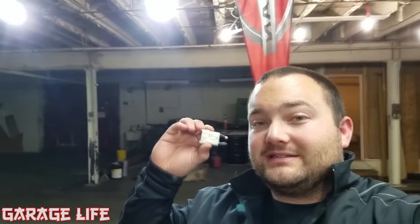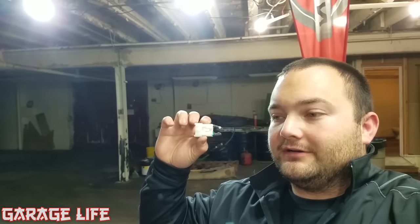Ron makes this — it's a lamp failure module connector bypass. What's actually going on with the Supra is the brake lights don't work. Ironically, what's making the brake lights not work is a lamp failure module in the back of the car, which I'll show you. Tony said the other day, 'You just need to rewire your car, it's your fault the brake lights aren't working.' It's not my fault — it's the factory stuff making it not work. I'm going to show you.